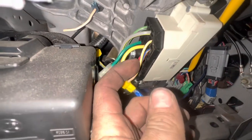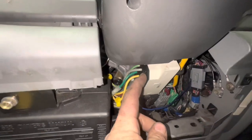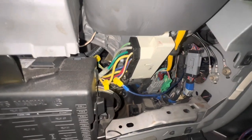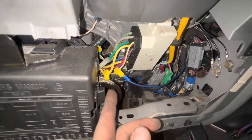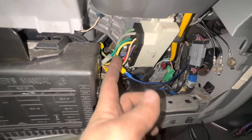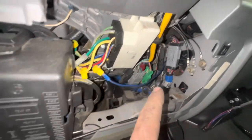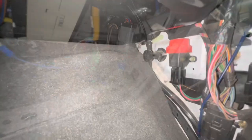That's your key 12 volts here. This blue wire comes over and runs across the dash to the other side. Blue wire runs over, comes behind the glove box through the dash — it's tucked up nice and neat behind there.